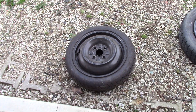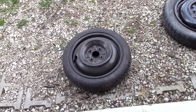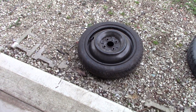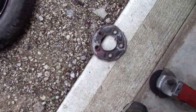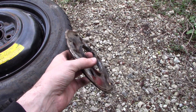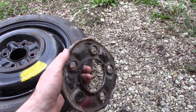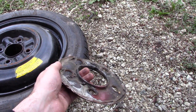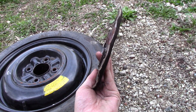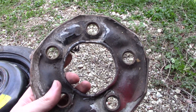What I do for every single demolition derby car after it's been ran and mangled before it goes to the scrap yard — if that car has steel rims, I will save every single steel rim whether it's mangled or not. What you will do is this right here. This is the centerpiece out of a steel rim off of the old Cutlass back in the day before we scrapped it. I had one steel rim that was completely mangled, no longer usable for a demolition derby. The lip around the bead was all twisted, could not save it. So before I scrapped that rim, I cut the center of it out because this center is straight, not twisted. The bolt holes are still good — they haven't been wallered out or sucked through with a lug nut. So it is a usable centerpiece.